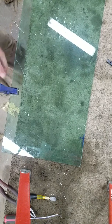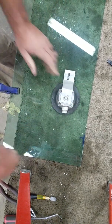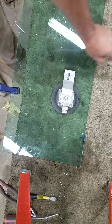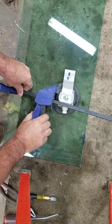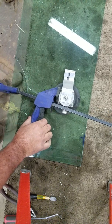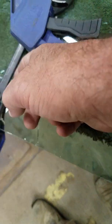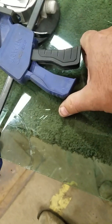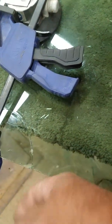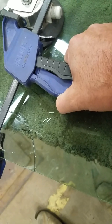Now we'll go straight in. So, just a little suction cup. These are handy for holding up back windows, and so I use this one to hold it off the bed. So you're just gonna put that against it, and this will give you a light pressure. And you don't want to go fast because you're going to break something. But you can already see I can stick my fingernail in there. So you just give it a slight push every once in a while and it'll open right up. And the heat has already opened this up. So just give a little light pressure.